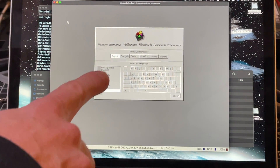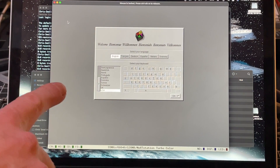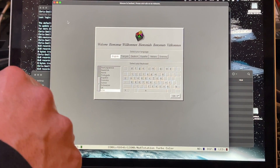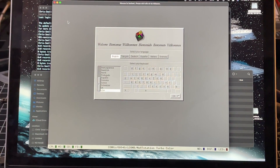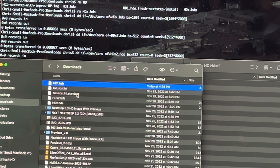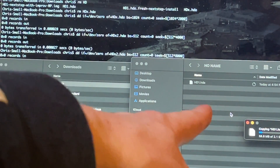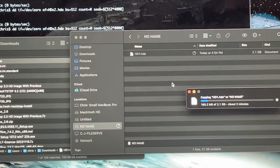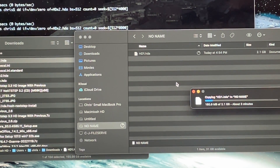We've now arrived at the start screen after the command-line based installation where it's setting up the keyboard. So we'll shut down the machine here, copy over the hard drive image to the SD card, and then that should be exactly the same screen that the NextStation will be booting into. After shutting down the NextStep emulator, we'll have HD1.hda as the image file — that's where NextStep has been installed onto through the emulator — so all we'll do now is copy that across to the root directory of the SD card, and once that is complete and the card has been ejected, it'll be inserted into the Zulu SCSI card again.